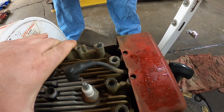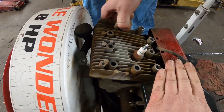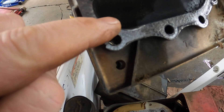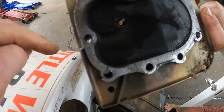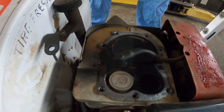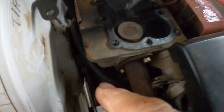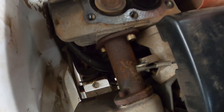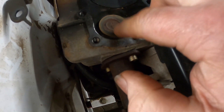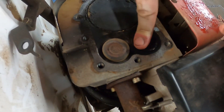Let's just see if the head will slide off. Pick up the head, flip it over — it's blown out in two spots. The piece is completely gone right there. Piston looks good. The exhaust valve looks good — it's burnt on top, which is how it's supposed to look. The intake is carboned up, which is also normal.